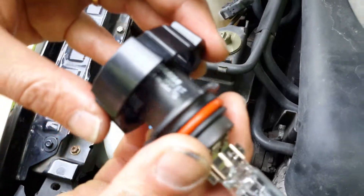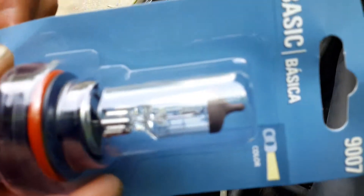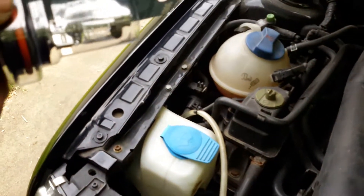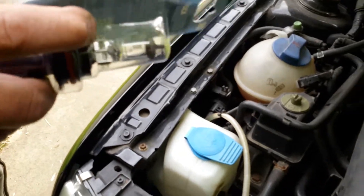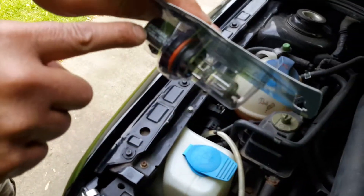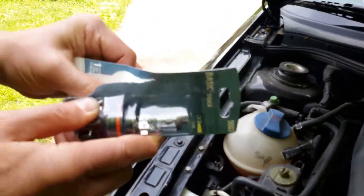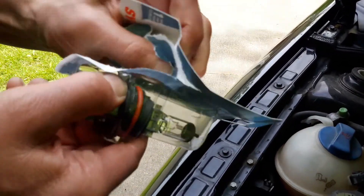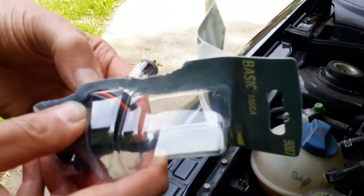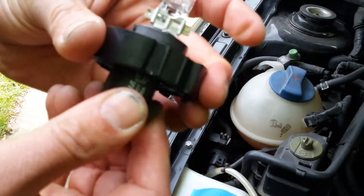So you're going to want to remove the plastic nut from the old bulb, and don't get your hands all over the clear part, because it could smudge it. Then you want to carefully open the package, but make sure before you tear into it that you compare those numbers so that if they're wrong, you can take it back. Then you're going to remove the bulb from the package and reinsert the nut onto the new bulb, like so.